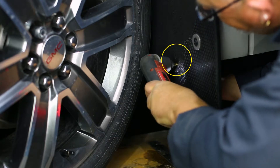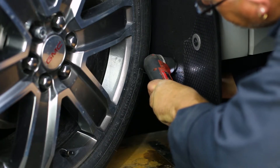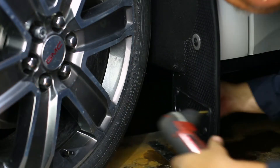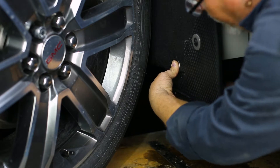Next, on the innermost part of the flap, using a quarter-inch drill bit, drill through the liner and mud flap. Now install the liner to the flap using the provided bolt and washer, and secure it with a washer, lock washer, and nut.